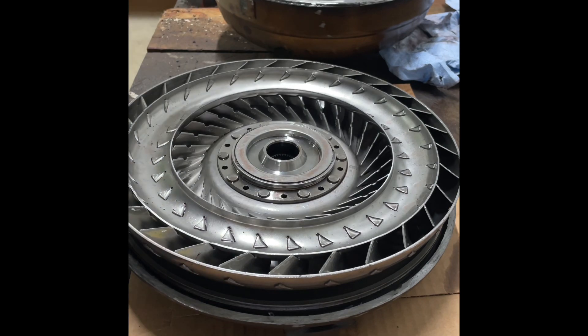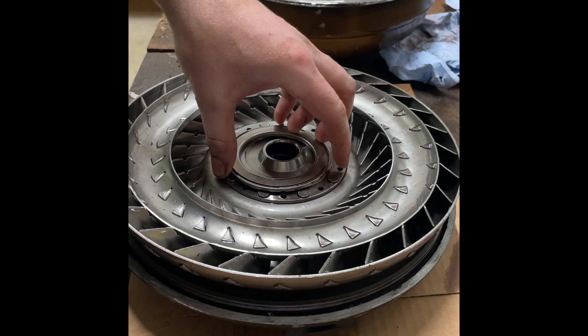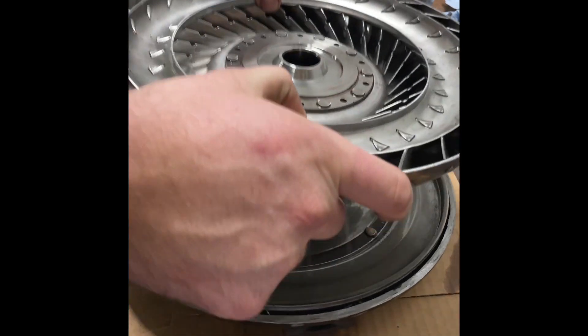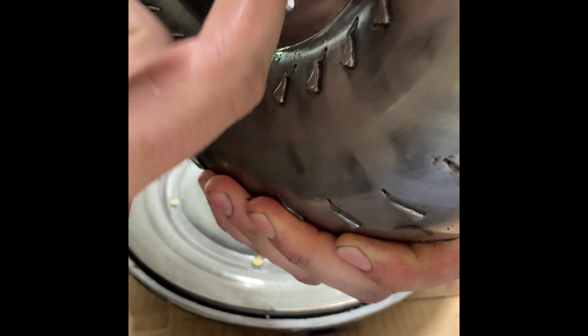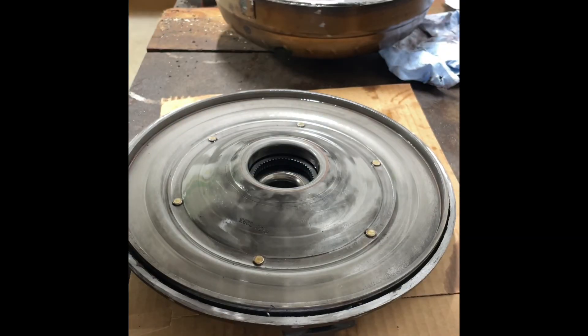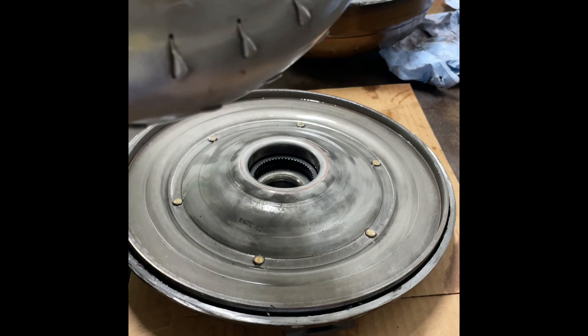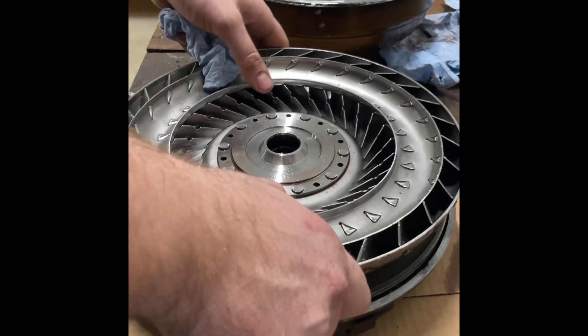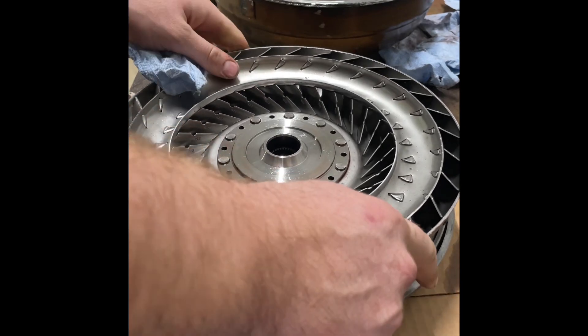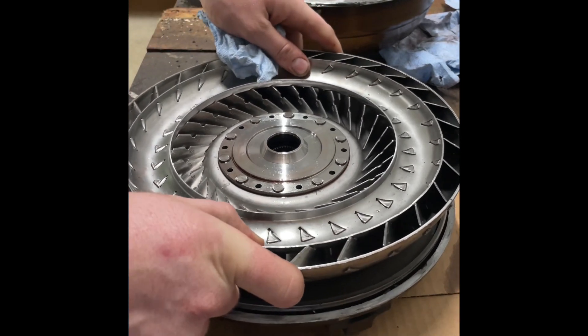What I really wanted to find out is how the lockup clutch actually works. I watched a ton of YouTube videos but people just talk about it without showing you. I figured it out myself. There is an o-ring that can fail - the o-ring on the turbine housing is completely flat, which could be a potential failure point. The o-ring for the lockup on the shaft that splines with this was also pretty flat, so I think maybe those o-rings had some leakage past them.